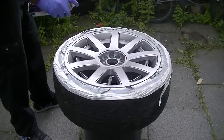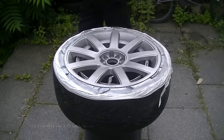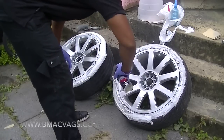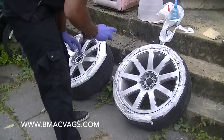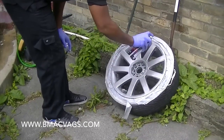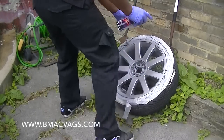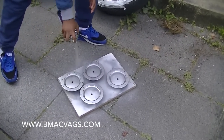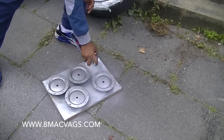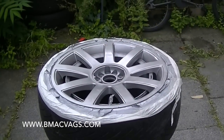Applying the lacquer - tack coat first, light coat, then slowly build up gradually. Try and get a good quality lacquer in a can and you should really reap the benefits from that. Take your time - you can see me getting a little more comfortable as I go. My son's having another go to show that you can do it if you learn. All the work really is in the actual prep. Hopefully it should look something like this towards the end, with a little bit of shine to it.